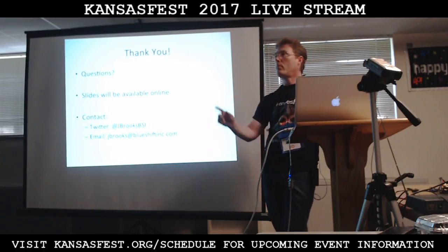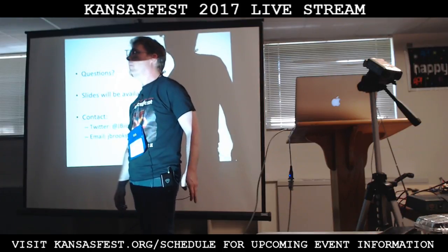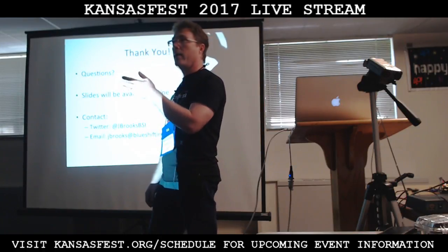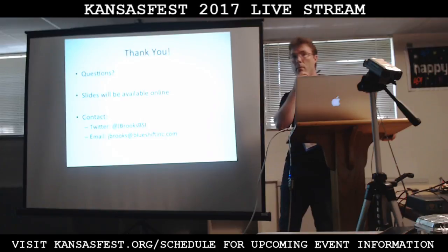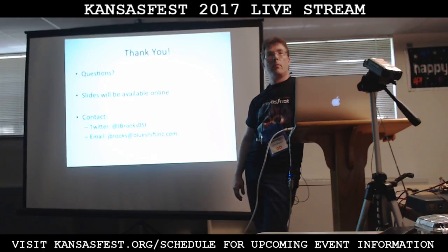Isn't there some problem with things that look like a clock that reset a year every 7 years or something like that? Does that fix this? I don't know. I've never been a no-slot clock guy, I've pretty much been a GS guy. The problem with that is that it only has a range of 7 years, and you actually have to patch the driver to tell it what year you were in. Apple even did that in subsequent releases. Another Thunderclock is that way. In fact, when you install A2 server from the Linux command line, it will look at the current date and patch the ProDOS that gets installed in real time. Okay, but that might just be an artifact of the existing ProDOS clock mechanism, and if you're replacing that, then maybe it could just be smart.